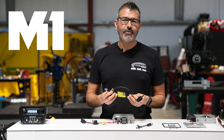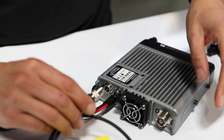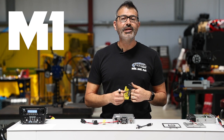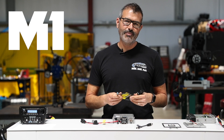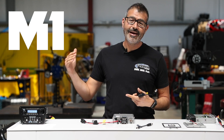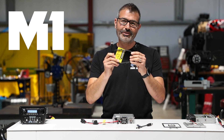Second is the remote accessory hub. This 28-inch cable allows you to easily mount the accessory hub in an easy-to-reach location. Anyone that's been in off-road racing knows last-minute changes are inevitable. Having access to radio programming without having to pull the radio, pull the dash, or hang upside down in the car is invaluable. So make sure you install this.